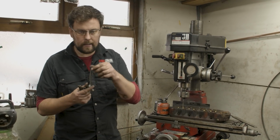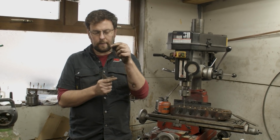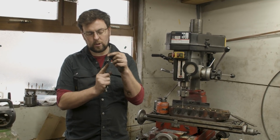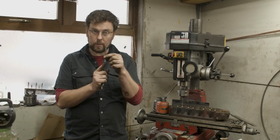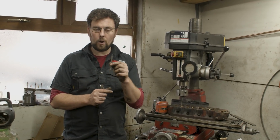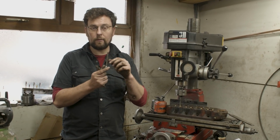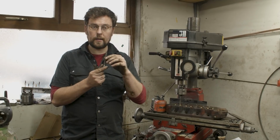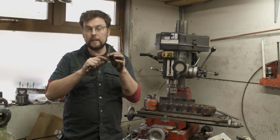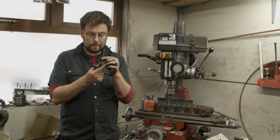The valve guide is what controls the valve and allows the valve to open and close. The valve is in the combustion process, meaning that a huge amount of temperature ends up in the valve from the combustion process. That valve needs to get rid of that temperature before it opens again, or else it'll be introduced to temperature again a second time, and the valve will heat up and up and up until such time as it either expands so much it'll get stuck in the guide, or the end will literally just melt off the valve. The way it gets rid of its heat is very simple.